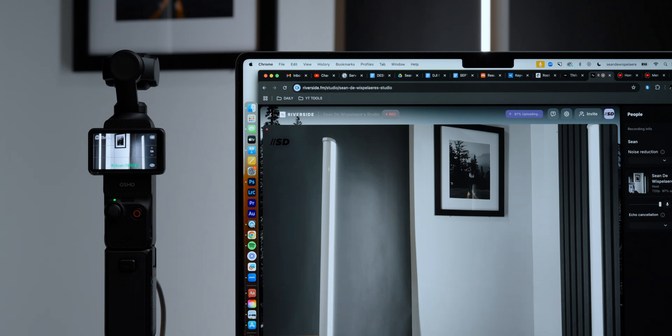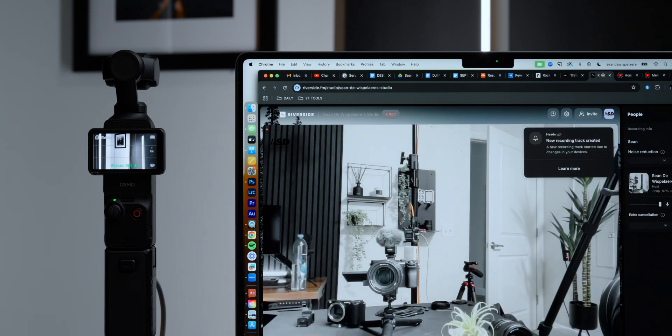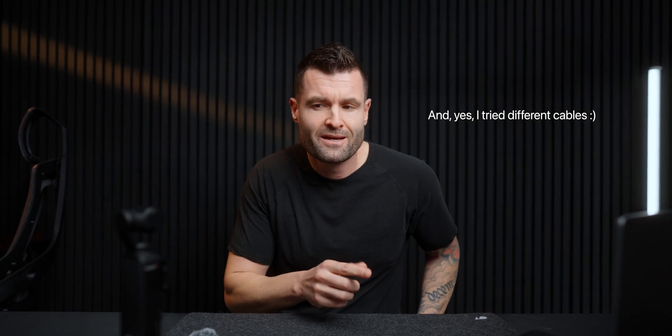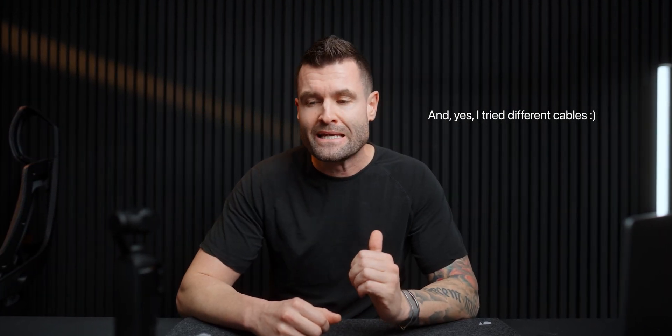But I did run into an issue, and this is the one that's making me question this camera's reliability. Using my M1 MacBook Pro — which will be important — this camera kept turning off between 20 and 30 minutes. It didn't shut down or overheat; it was almost like the computer just stopped recognizing it and would turn off the feed. That was when I had my computer plugged in charging at the same time. When I unplugged my computer, I was able to get the camera to run for the full 90-minute test. After some research, I found that specifically with M1 MacBook Pros and this camera, not being recognized between 20 and 30 minutes is a common issue — which is really disappointing and certainly a deal breaker for me.